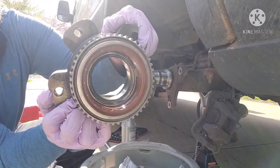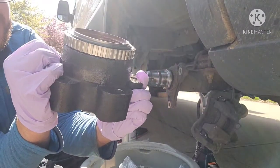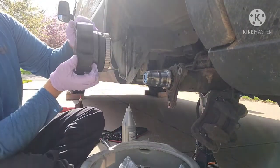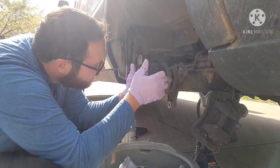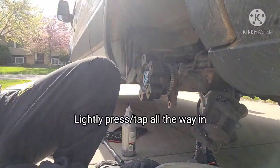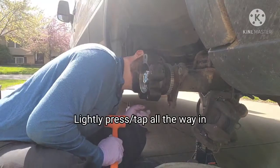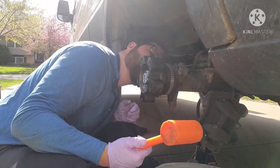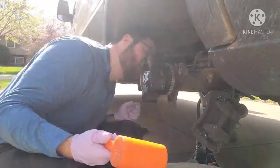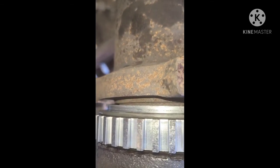Take our newly rebuilt hub. Got the new seal, new tone ring on there, wheel bearings in there. I'm gonna slide this back in. Smacked in. This is about the distance I got. The hub kind of hangs because it's not fully supported by the inner bearing, but about that much